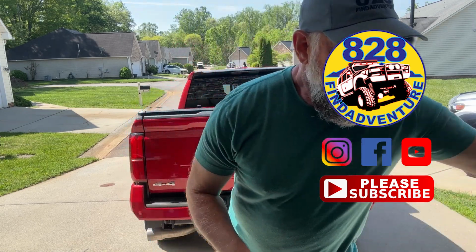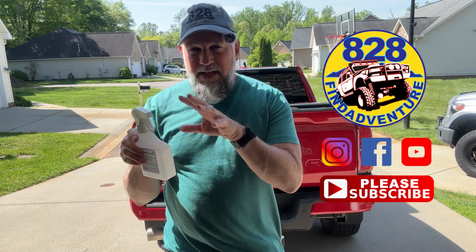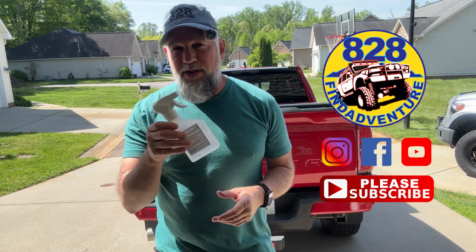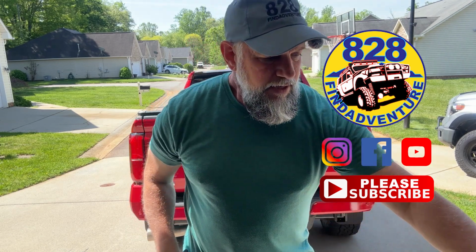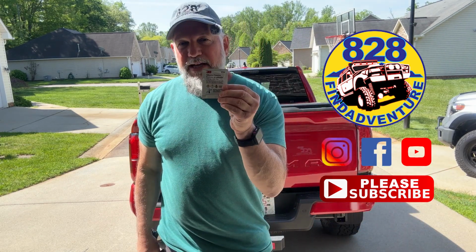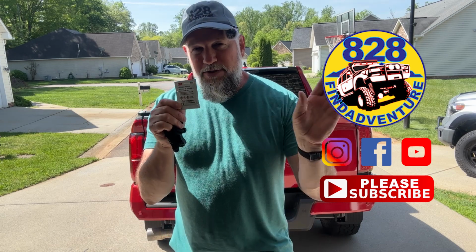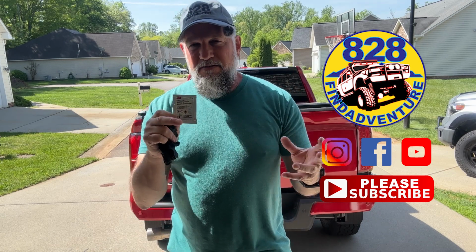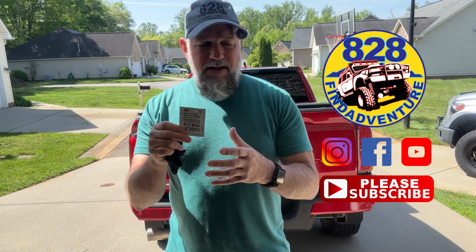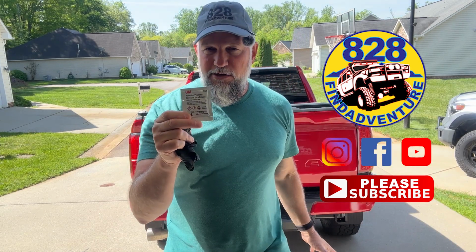First thing I'm going to do is clean them with some alcohol, because there's a lot of pollen around. I'm going to clean them with this and a microfiber. Then I'm going to put some gloves on, and I'm going to use a 3M Adhesion Promoter. Basically what this does is it preps the surface and makes it, I'm not going to say tacky, but gives it a nice surface for that all-weather tape to adhere to.